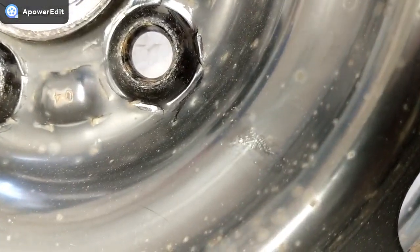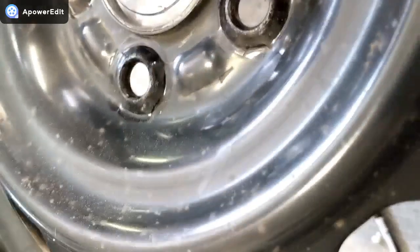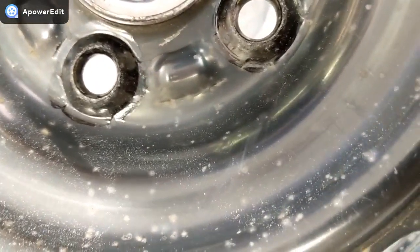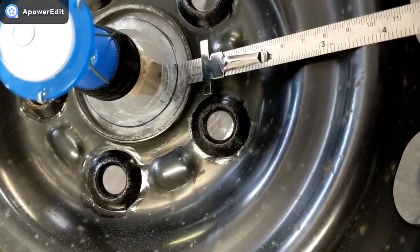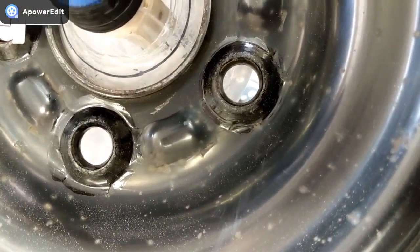So, what do I have? 6 millimeters. So, what do I have on this side? 4. Okay, so I've got to push this side a little bit. There. Cross-check first. The cross-check is actually fine, so that doesn't need any adjustment, so it's only this direction. It's about 6, and that is about 4. Okay, so just a little bit of push from that direction.